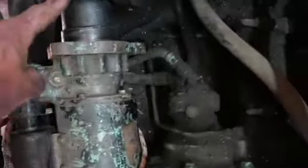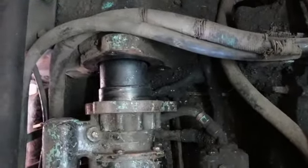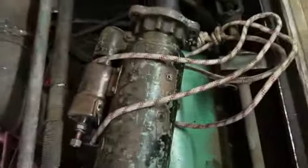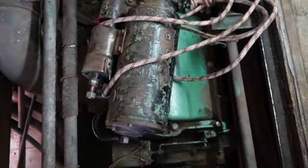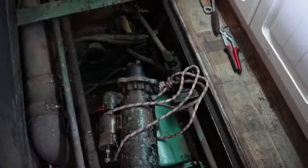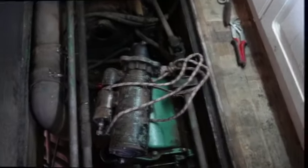So the technique I've got is like a sling, because that's to come out. And then I need it to clear. Yeah, I can't hold the camera and do that, so back in a sec. And with a little bit of jiggling, twist it round so the solenoid is towards the engine flat, and it then slides under the blower enough to release that end. And here it goes. Using the sling makes it a lot easier by yourself. And now let's get it outside and see what's jammed.